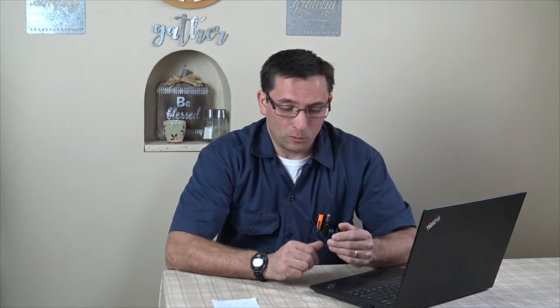Getting started, we had a 2008 Chevy Trailblazer with a 4.2 that came to the shop with a P0303, so we knew for a fact cylinder number three was misfiring. This vehicle had brand new coils on it — a set of six of them — so you know somebody had been playing around already.